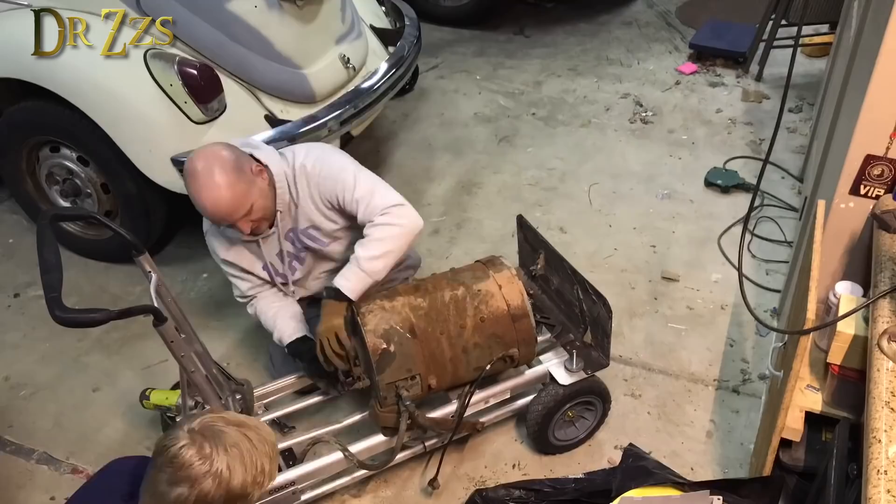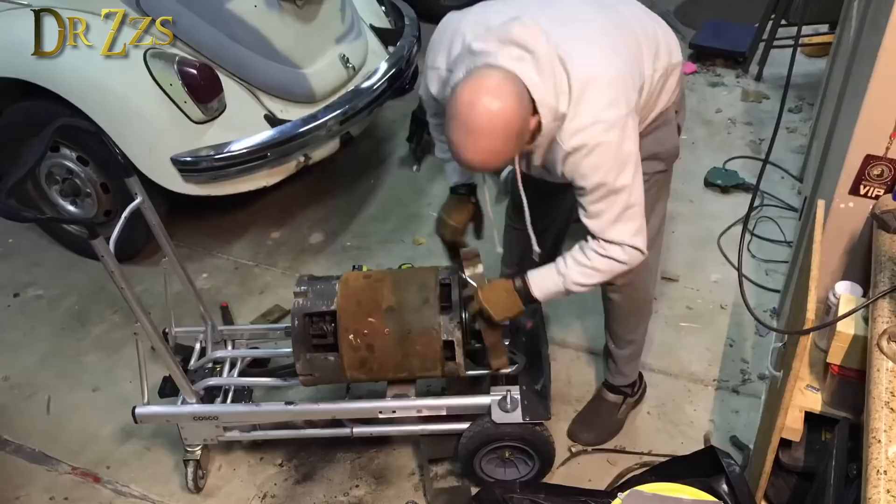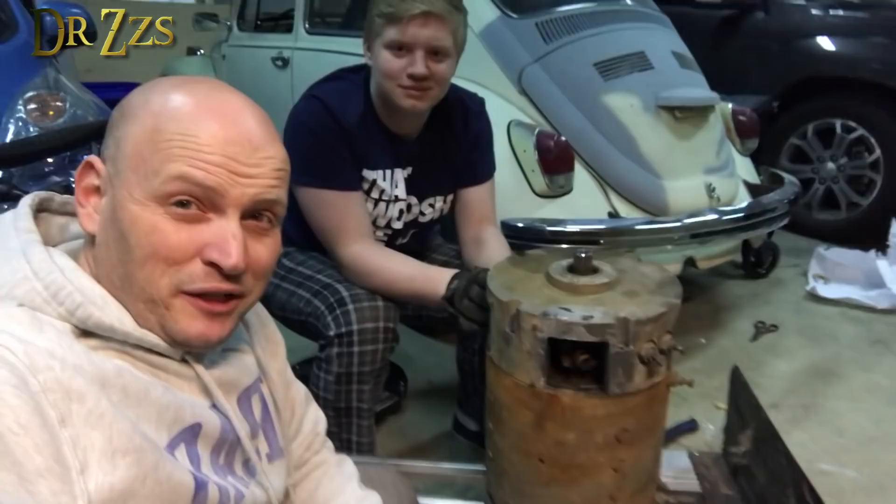The parts that we took off are actually some kind of a brake. It's good we had those brake parts because I ended up using them to create the coupling that joins the motor shaft and the transmission shaft. Without those brake parts, I would have had to have somebody make some kind of custom gear, so I'm really glad we had them.